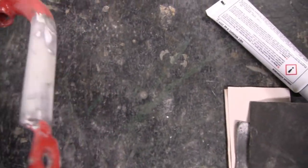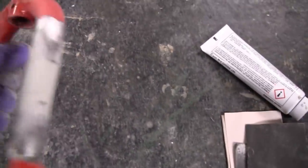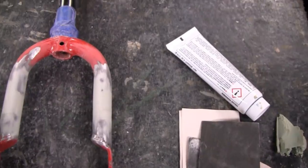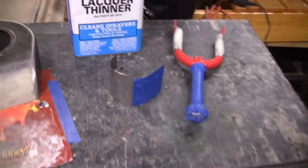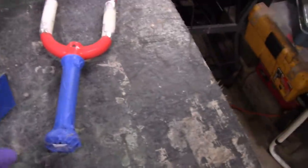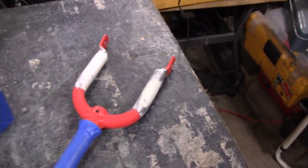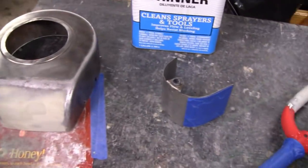Yeah, we're happy with that. I mean, they're as done as they're going to get — they are just forks and they are down low, so they probably look better than they really should. If it wasn't raining out, I'd take them out and prime them, but it's raining out so we'll have to wait on that. Maybe we'll move on to something else. It's another day and we've got some nice weather out there — a little hot, but good enough for painting. We just cleaned these up with some lacquer thinner, and I'm going to take this one out and prime it and top coat it. Same with this — prime it and top coat it. The forks here I'm just going to prime them and give them a good heavy coat of primer because I don't have the top coat for that yet. I'm going to try and match that color so I don't have to paint the whole scooter. Let's go outside and get some paint on these.